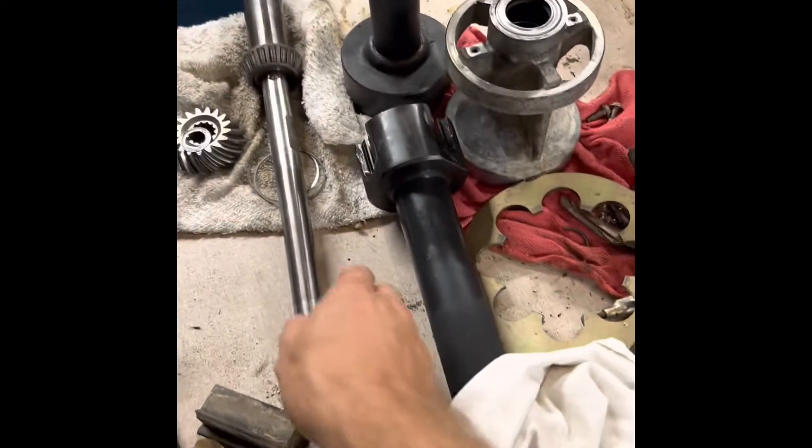We're going to set in the top shaft now. The top shaft is right here - it's this little guy right here. First things first, we definitely want to clean it down. We're going to spray some brake cleaner on the threads because you're going to need to put Loctite on them anyway. Check your shaft for any pitting or anything else. Check your bearings, make sure your bearing looks good. This shaft was actually in really, really good shape - it had no pitting whatsoever, so it's definitely reusable.